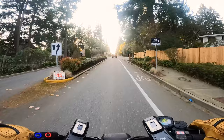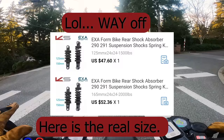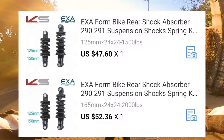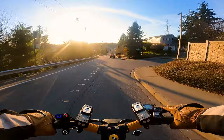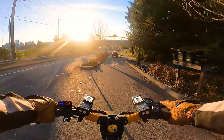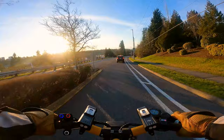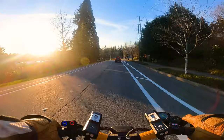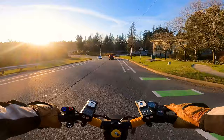I'll put the real sizes on the screen - I think it's like 275mm for front and back, or 250. I'll put the sizes on the screen for the EXA Form 291R shocks that fit on the front and back of the Vset. This is a great upgrade for anyone that knows their way around the scooter. The springs are a lot stiffer, and it also offers you rebound adjustment so you can adjust how fast the springs bounce back into their original position, which is even better for high-speed cornering. I personally like having the 291R shocks - I had them on my Varla Eagle 1, which I believe is the same rear setup, but you can't put it on the front and back on that scooter. But on this scooter you can put those shocks on both the front and back. With the EXA Form 291R shock and the PMT tires, the scooter will be a lot better for anyone that knows their way around it.